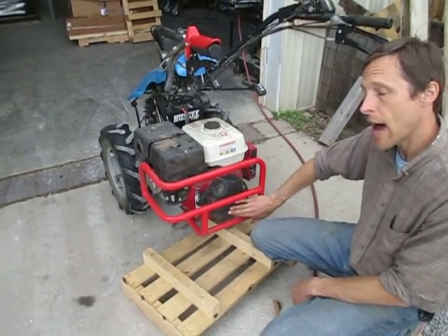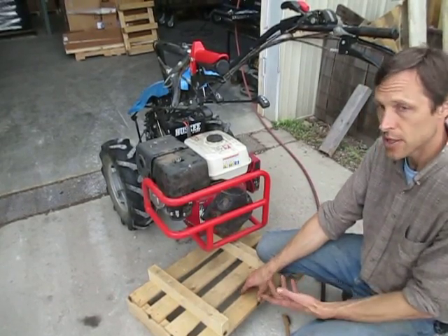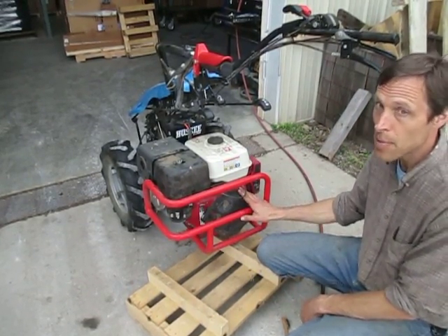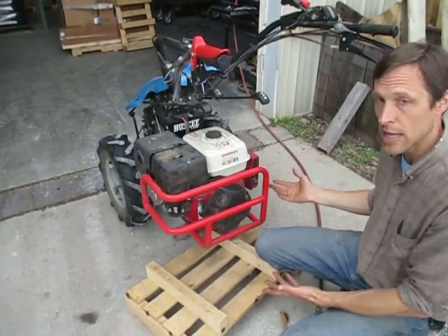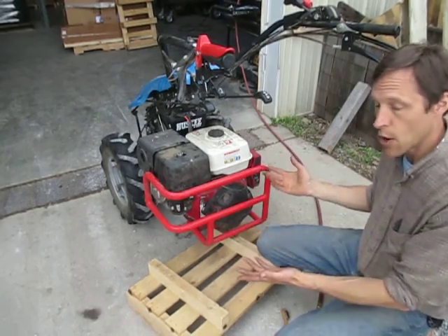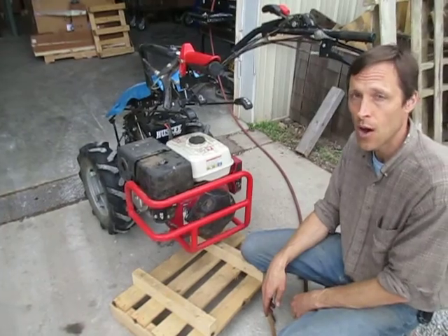It's critical to keep an eye on this, especially when you have more lightweight dry material being mowed, because if this plugs up it'll have the same effect as if your cylinder fins plugged up — you'll still overheat the engine. I have seen engines with blown head gaskets as a result of this getting plugged up and people just not paying attention to it at all.